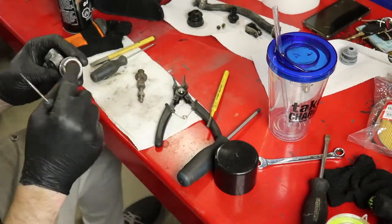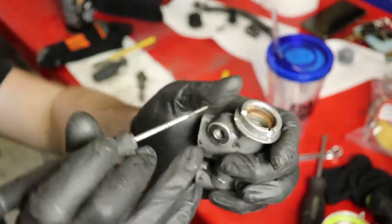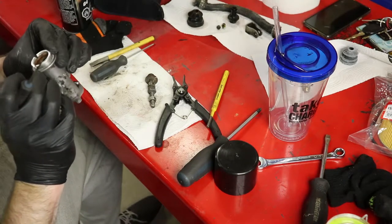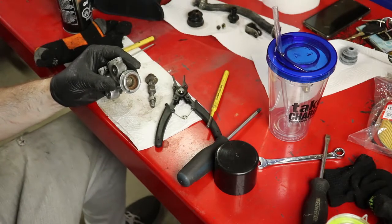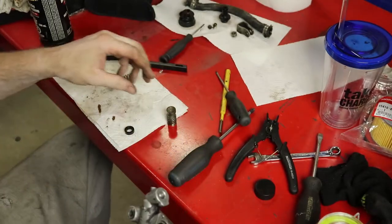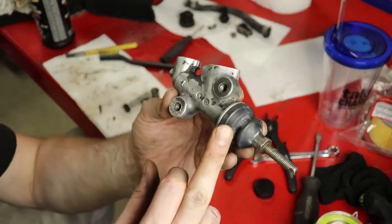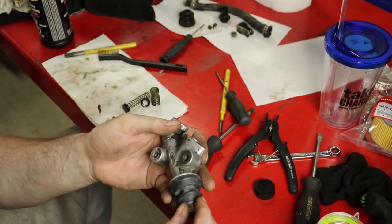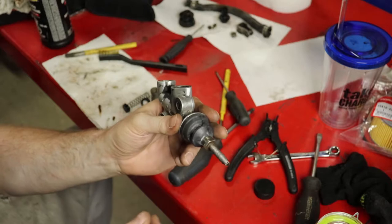I managed to get the plunger out by getting the circlip out. To get the circlip out I had to actually cut down into the side of the housing so I could punch it out from the inside — it was just completely rusted onto the cap and there was no way it was coming out otherwise. This will not affect performance whatsoever as everything is sealed behind the plunger anyway. I've got this all apart now, got the new piston and seals and everything in, so this should be a good non-leaking rear master cylinder. I'm going to go ahead and put this back on the bike, get everything hooked back up, see if we can prime those brakes, and see if this will hold brake pressure. It feels a lot better, I'll tell you that much.